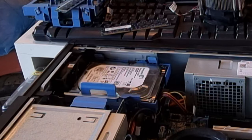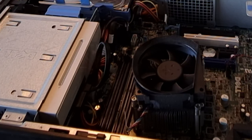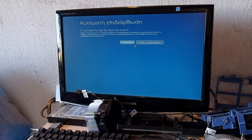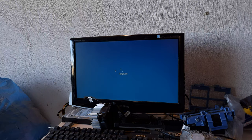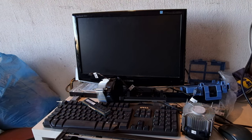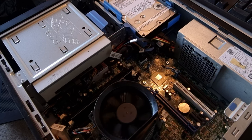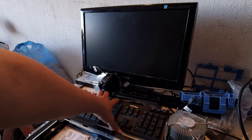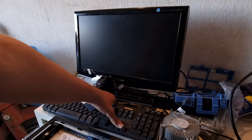As for the fourth Dell, it had a newer hard drive from November 2014 and absolutely no RAM. So I put some RAM in for that thing to function, and it posted on the first try to a CMOS error. After some BIOS configuration, I booted into Windows 10, but the computer went straight to automatic repair reporting the PC didn't turn on properly. After pressing restart, the OS started up as it should to an old build of Windows 10 that hadn't booted since early 2020. The computer works properly — all it needs is proper RAM and a clean install of Windows. The last of the five Dells had corrupt BIOS, making the system unfixable unless you have a ROM chip programmer, which I don't, so that PC is unfixable unless the BIOS gets reflashed.